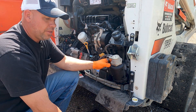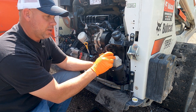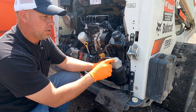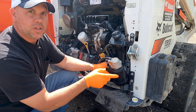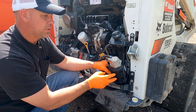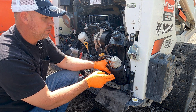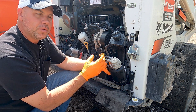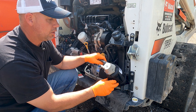Now in my other video with the old filter, I don't ever usually take the top bleeder plug off to help bleed the system, because usually you can just pump it up and it's not a problem to get the air pushed out of the system. However, with these larger fuel filters you can still do it without pulling that, but it's more difficult. It takes more time, and we want to keep air out of the system. So I'm going to go ahead and back that out and get this primed up real quick.